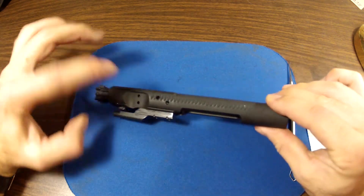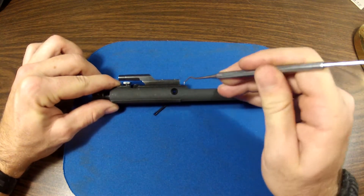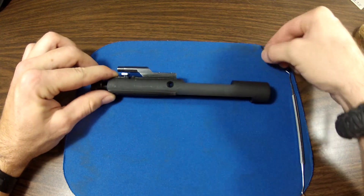Let's get started. Move to the left-hand side of your carrier assembly. Pull your cotter pin straight out. Put it in a place where it won't hide from you.